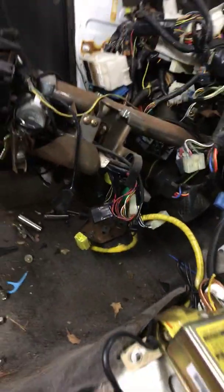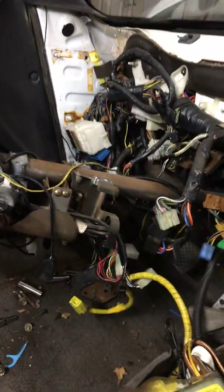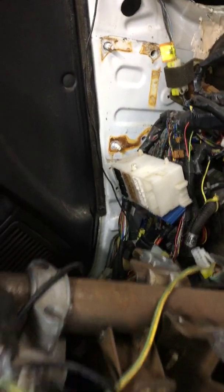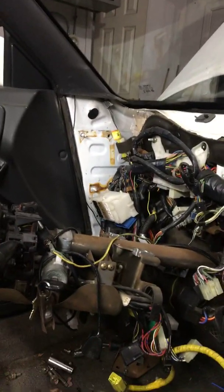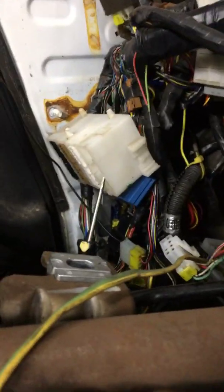Go down below the steering column. You're gonna do the kick panel, hood release. It looks like you need to take a little bracket off over there, but you don't. It's actually a 10 millimeter that's going into the A-pillar. That white plug there, those are tricky. Just slide a screwdriver up behind and put a little pressure right in the middle there. You see that recess? I'll point to it. Right there. Stick the screwdriver up behind and push. They'll pop right out.